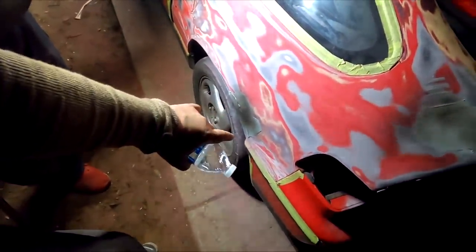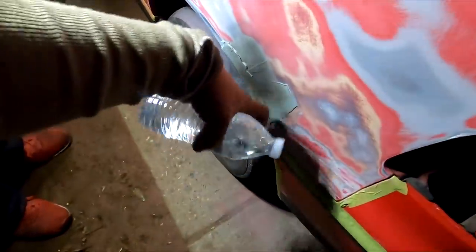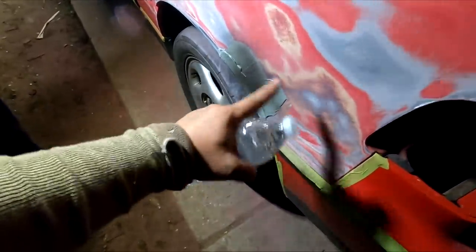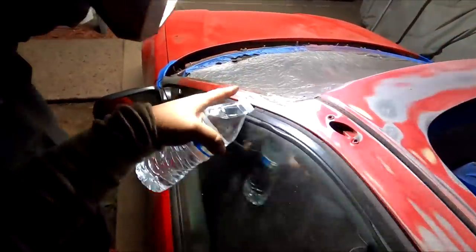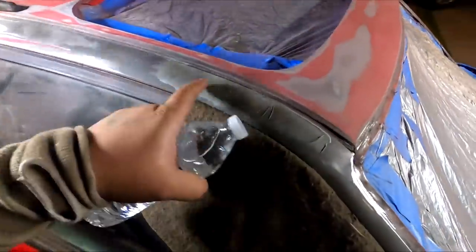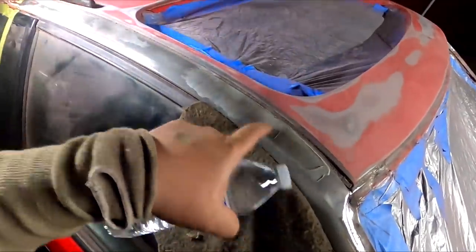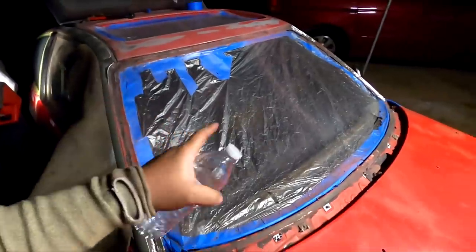Leo has been going to work with the sanding block. He did the filler work here — the first layer he put on wasn't quite enough per the dent size, so he had a low spot. It's been hardened for a while now, he blocked it out, has some guide coat still in there which you can feel by hand — there's still a low spot. He went back and filled that. He did this one right here — on the first shot he did it really great, nice and smooth with a block. We're gonna do some filler work to this right now. He got down with the back side here and found some small little dings. Quarter panel on this side had already been done, but he did get up to the top here. This was a low spot — he filled it in, and I could see the low spot even on top of the first filler work, so this is the second coat.